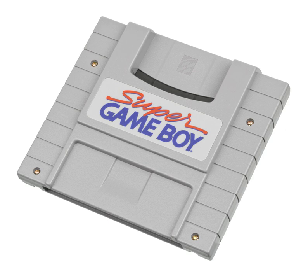The Super Game Boy is the successor to Intelligent Systems' Wide Boy 2, which connected to the Famicom or NES. One difference between the Wide Boy and the Super Game Boy is that the former did not use any part of the Famicom/NES other than the video memory. Even the controller is hardwired directly into the Wide Boy, which would continue running even if the reset button is held down on the Famicom/NES.